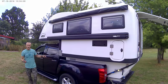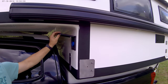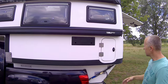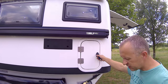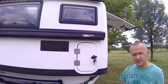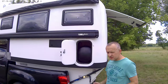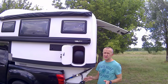Okay guys, if one of you will come with me. Here we've got an electricity outlet for power supply, 230 volts. This is the winter cover for the fridge. We are using a compressor fridge, which is the BASCO EL65, 65 liters capacity. This is the gas locker, so we supply heating and cooking in two versions — gas version and diesel version. In this one we fitted a 28 liter LPG bottle. It's fitted for good, so you don't need to look for an exchanging point for gas bottles when you are traveling around the world or anywhere in Europe or even in your country.